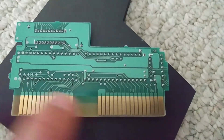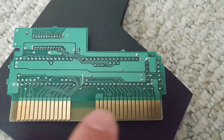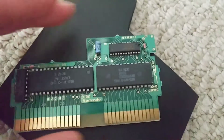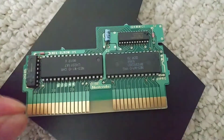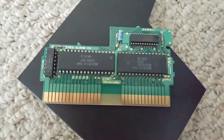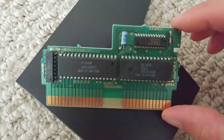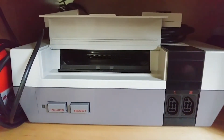These pins on the end don't get cleaned as well as the other pins when you're trying to use any of the methods to clean them. I like to use an up-and-down motion. I also like to use electrical contact cleaner or a pencil eraser. Cleaning your games and cleaning the 72-pin connector is all that you need to do.